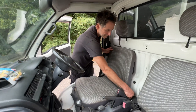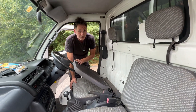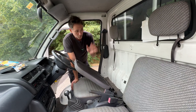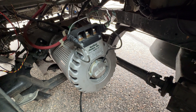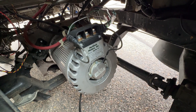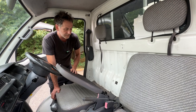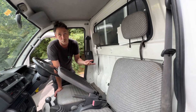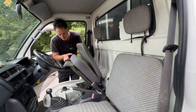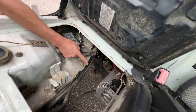What made you choose a Hyper 9? The Hyper 9 is overpowered for this — it's about five times more horsepower than originally. But I know the Hyper 9; Hunter at Net Gain is amazing. So I thought, let's do a Hyper 9 — it's good for teaching. Plus you don't need more than about 125 volts, so you don't need a full Tesla pack.